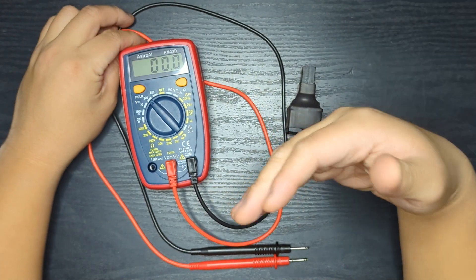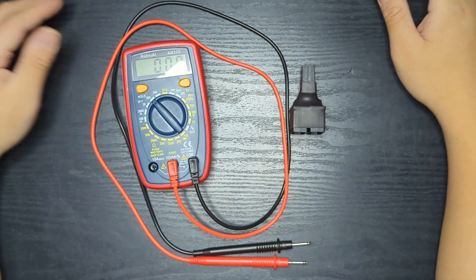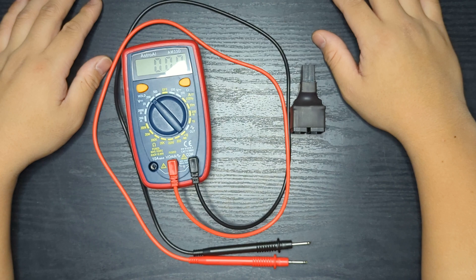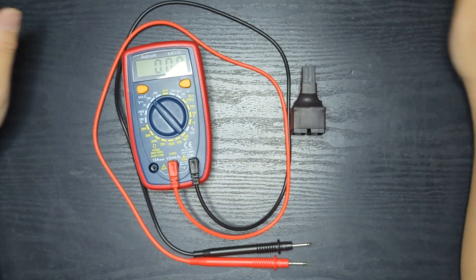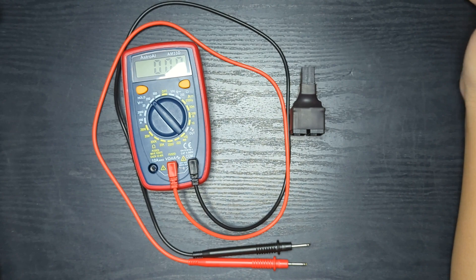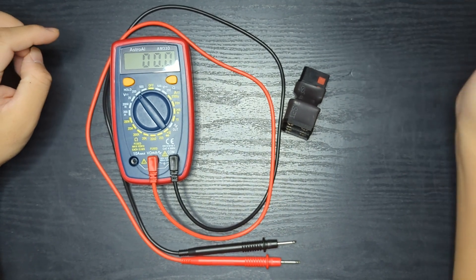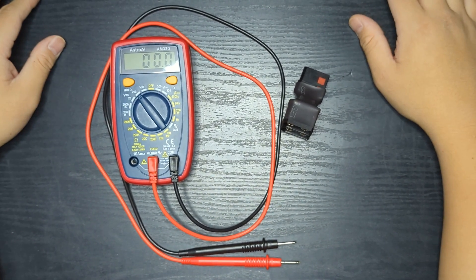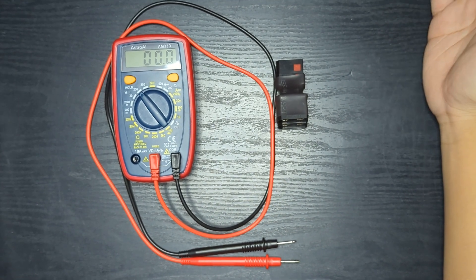Now, you guys know about the battery blender and the Datex connectors — I think it comes in like a 35 amp version, a 60 amp version, and a 90 amp version. I used to use a 90 amp version of the battery blender and it was good for connecting my 20 amp batteries together. I think I was using LG cells or something like that, and it was good — I was getting a little bit of an increase in top speed. After doing some additional tests, connecting the batteries in parallel actually increased my torque a lot, a lot better than the Datex or the battery blender. We tried it on Sal's bike, tried it on my bike, and the difference was pretty much like night and day. So if you guys are interested in connecting your batteries in parallel, I'll be showing you guys the step-by-step process.